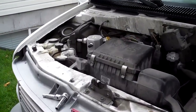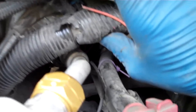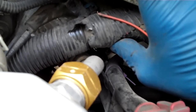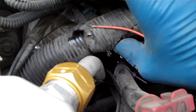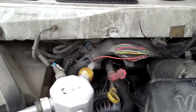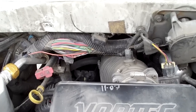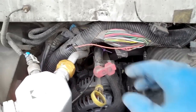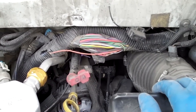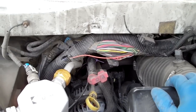I'm going to have to do something to retain this wire harness so that it's up, and I'll have to open it up and see if there are other wires that are affected. The customer thought it was the same problem — he just knew the check engine light came on last time and that it ran crappy. It's running crappy, and I've got a misfire on cylinder number 3 too. That might be related — it might be an injector wire or something for cylinder 3 that is causing the miss. We'll check it out and see what the deal is.